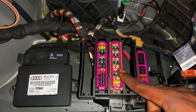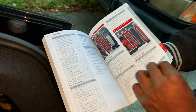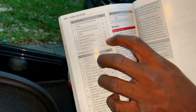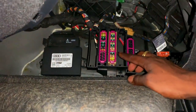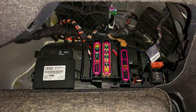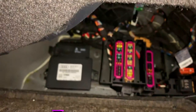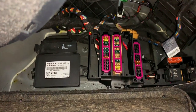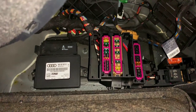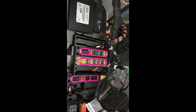Just for any Audi enthusiasts out there — on the manual it shows that on panel C I should have a Quattro Sport 35 amp fuse, but on my A4 Quattro S-Line I don't have a 35 amp fuse. If you have any answers to that, leave a comment. Anyway, the 12-volt cigarette lighter is number two, right under the 30 amp luggage compartment lid control module — so that's this 20 amp clip right here, and apparently my 20 amp fuse is burnt out.